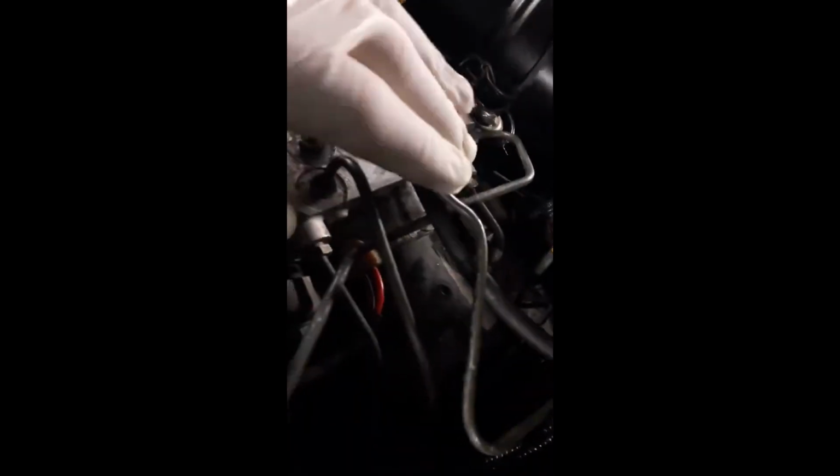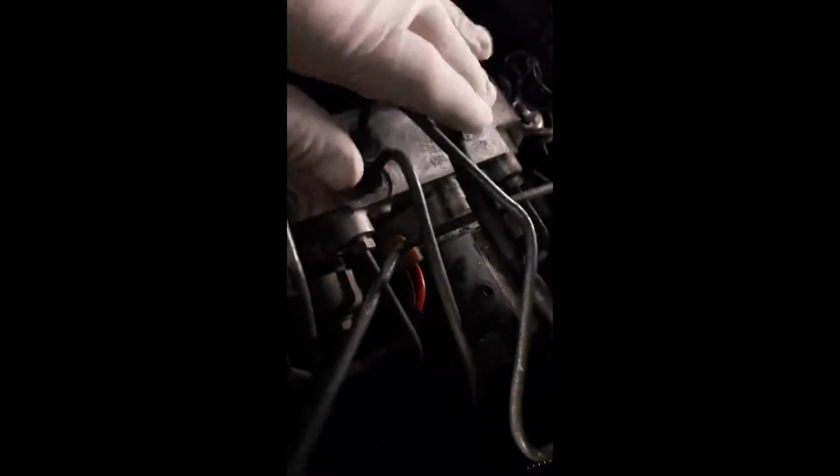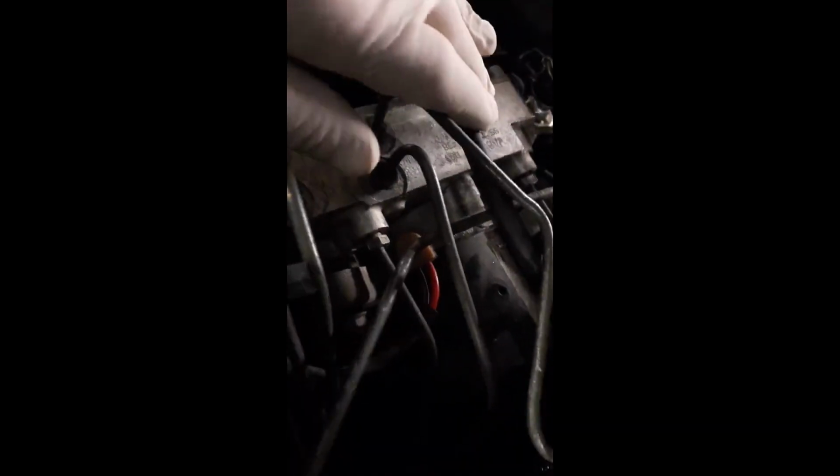Stop pumping when the force between pumps is equalized. So every ABS system works on the same principle, but it may be plumbed just a little bit differently. Let's get some autofocus in here. There we go. And I bled this both with no actuation, and then I bled it with the motor and the solenoids running, and then I bled it with just the solenoids running.